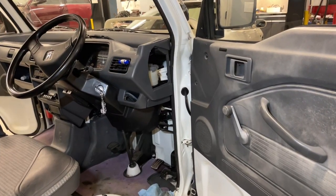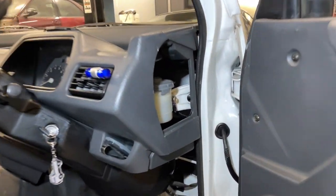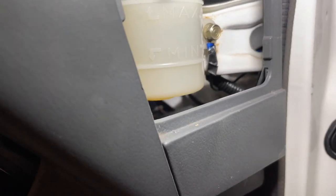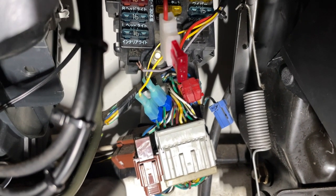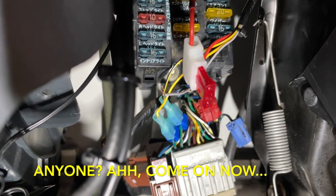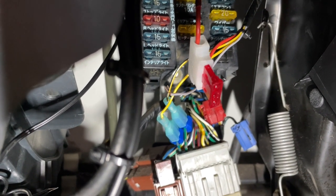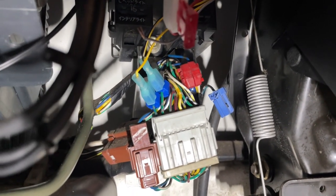We've got both door panels back on. Functional check — lights are working, door locks actuating with the door panels back on. I dropped a ground right there for the receiver box, and I did two-side tape the receiver box. For the blinkers — you're looking for the green with yellow stripe and the green with blue stripe. Hook into those two and that will make you blink to indicate that you've locked or unlocked the truck.